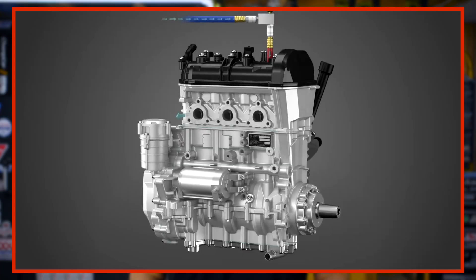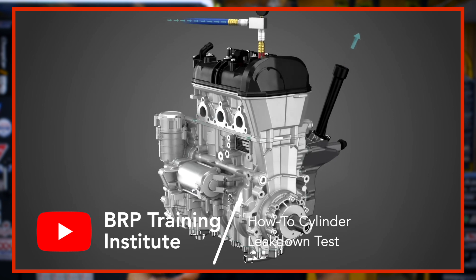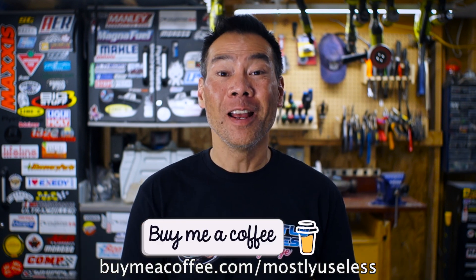It's worth mentioning that a compression test is just one way to determine the health of your used motor while sitting on your engine stand. If you have the tools, you could do a leak down test to gauge the condition of your valve seals, or maybe a borescope to investigate the physical state of your pistons. I'm really interested in hearing what other tests or procedures you do on your used motors before they go into your project car — drop those ideas in the comments below. If you found any of this helpful, please like, subscribe, comment, bell, and share the video. Until next time — you're awesome, I'm useless. Thanks for watching.